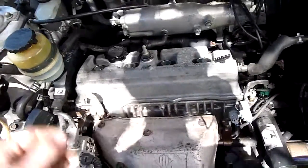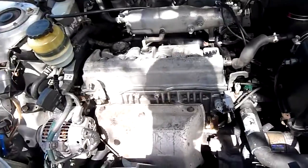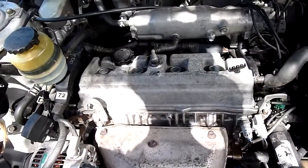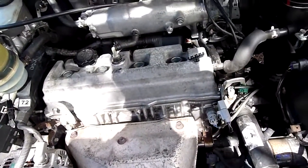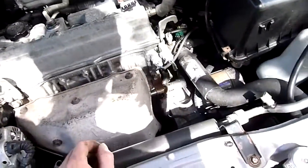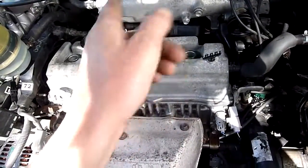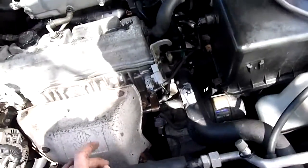as you can tell by the top end wear through neglected oil changes, which is more than likely what that is. It might not be the spider or scissor gears, but it's more than likely the shims on the valves are cupped or dished from wear, as well as a bit of wear on the lobe. The gauges I'm using are fairly wide, so it might be spanning that dish and giving me a false reading. That's another thing I considered before. Either way, it's not terminal.